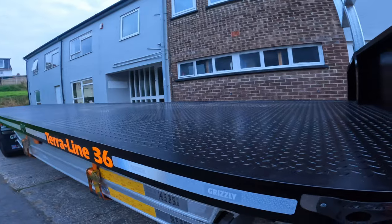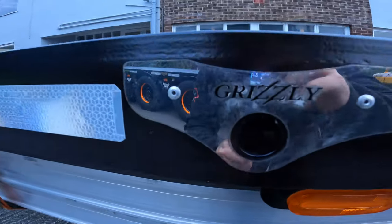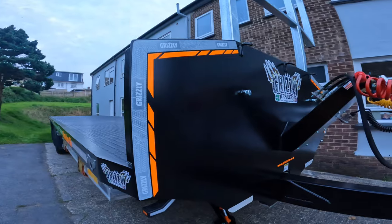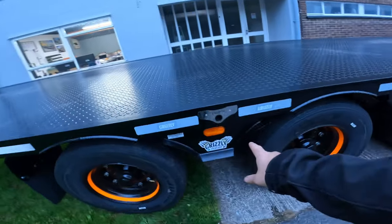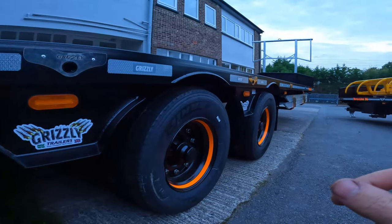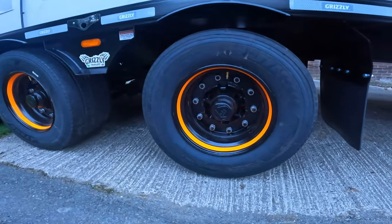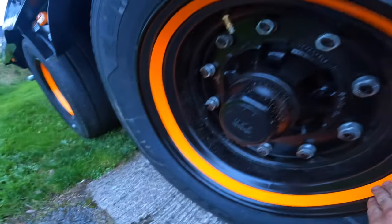It just utilises the trailer a little bit more and they look quite smart with the mirrored finish. All our normal Grizzly finishing touches — HiViz tape and HiViz orange vinyl on these just to break everything up. LED neon front marker light around the side, our wheel infills with indicating marker lights all the way down the trailer. Our usual 127 round beam commercial axles, running on 445/45/19.5 mini super singles, done with HiViz orange pinstripes on the wheels and the rims sprayed black.